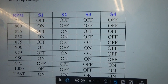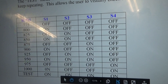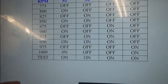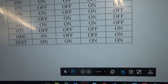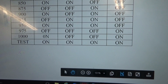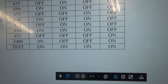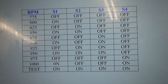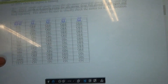You can really set it to whichever RPM you desire for whatever purpose you may have. The test mode, according to Dave, will slowly swing the idle motor from full closed to full open and then keep repeating. This is sort of a diagnostic tool that allows the user to visually check the idle speed motor for sticky operation.